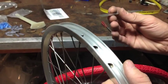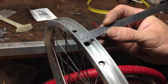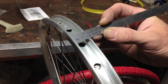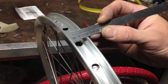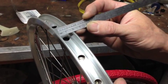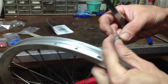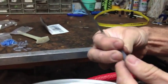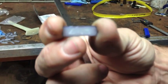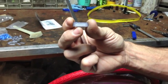If you don't have a digital or dial caliper, you can also measure your rim just using a regular ruler. So in this case here, we can see that it's just shy of 18 millimeters, so you know that you want to get a tab that's about 21.5 in width. So again, if we go over to the tabs, we can see that the purple is marked at 21.5 millimeters, which is 3.5 wider than that inner measurement. So again, the purple is the one we're going to want to use for this particular tire.